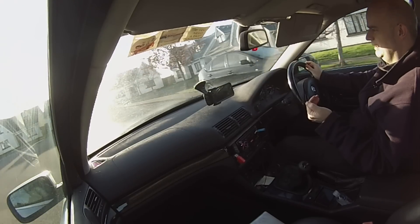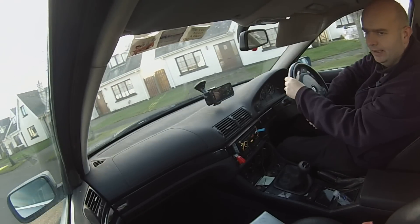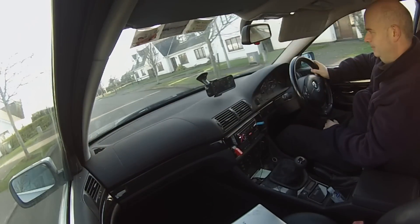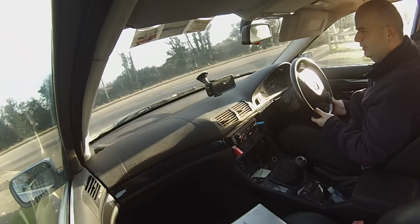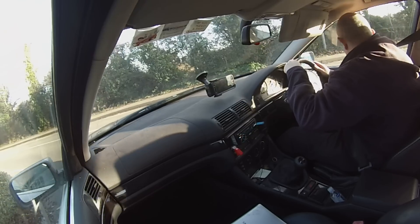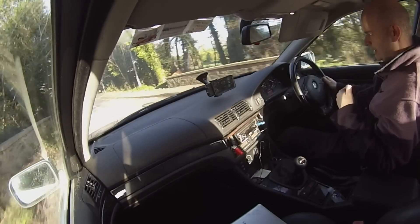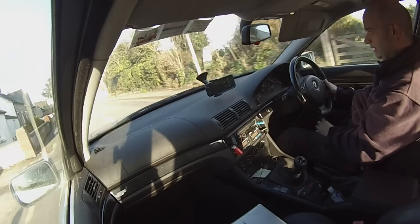Having the slip turned up high has meant I can maintain speed against a hill, but my current limit is catching me every time I pump the throttle. There's a little shutter — nothing too major, nothing you'd be worried about. Pulling out onto the road I'm pretty sluggish, but the revs came up and I can actually get some decent acceleration — I've kind of gone over a hump in the rev range.